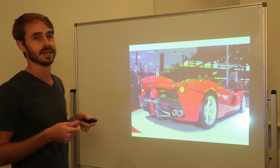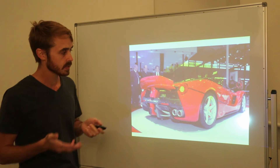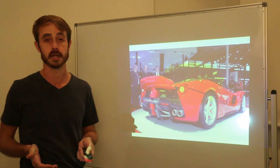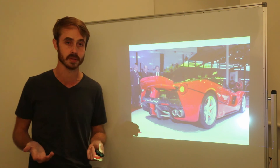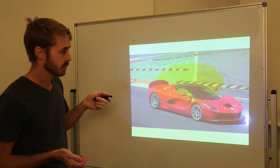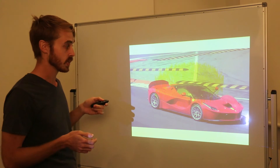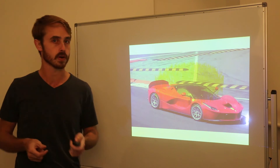Looking at the rear wing, it's not really a wing — it's actually a lip spoiler, and I don't fully approve of this. I agree it's a good-looking solution, but I feel they could have gone for a more efficient wing like the other manufacturers have done. I think this is one of the reasons why the LaFerrari's coefficient of downforce is so much lower than the others. On track with it deployed, it looks like it may be in an airbrake position — with airflow coming over, it acts like a giant gurney flap. You'd anticipate some downforce from this, but it's not going to be a very efficient form of downforce.